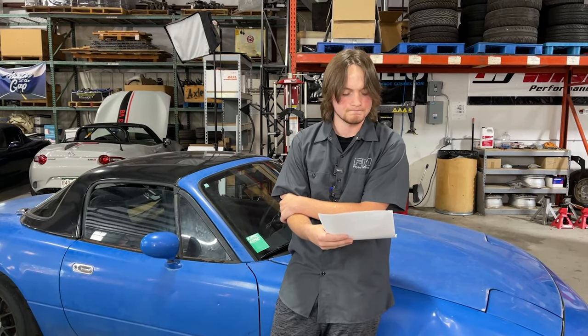Moving to more expensive upgrades: anything to do with chassis stiffening is a really good idea for pretty much any Miata for any use. That goes for frame rail braces, butterflies, strong arms, shock tower brace, rear cannon brace, roll bar — anything you can think of. To put it simply, think of an old noodly chassis as an undamped spring. If you hit a big bump, a lot of that energy gets sent into the chassis in almost a shockwave effect, rather than letting the suspension do its job.